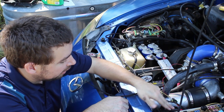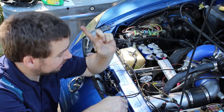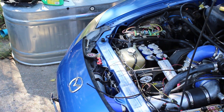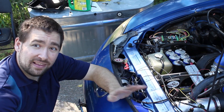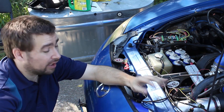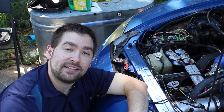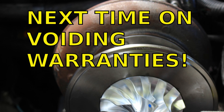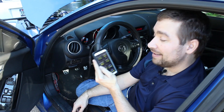All hooked up. I have the leading spark plug attached to the leading coil, which is attached to the leading signal — and this is for leading in housing one. Let's fire it up. The engine can't tell the difference. This means that my ignition coil mod will work. I just need to make it more permanent and less sketchy. If you've liked this episode of Voiding Warranties, please click the like button, and if you want to see more, please subscribe. Next time: being able to see perfect timing at idle and adjust timing at idle is just a novelty, but being able to do the same thing under boost — now that'll be impressive.